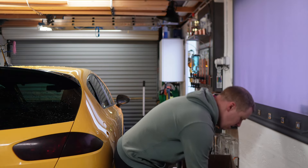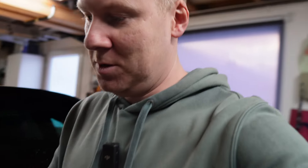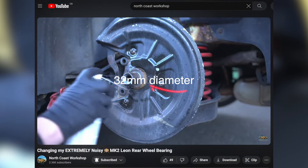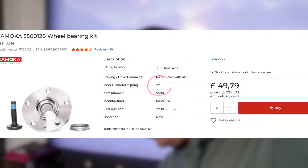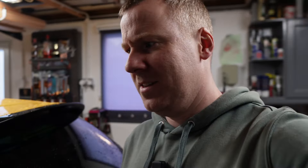Here's me walking through the snow to get to the garage. Here's me putting a box down and raking through it to get the pipes out. Here's me talking to the camera unaware that my microphone isn't working at all - it hasn't recorded any of this next segment. So basically I'm super chuffed because my AutoDoc order has arrived, the brake pipes are among it, and it means the job isn't going to be halted for a few days. Now I'm explaining why I haven't fitted the second wheel bearing to the other side - both my hubs on the back are slightly different. The mounting shafts are 32mm on one side and 30mm on the other, so I'm now short the wheel bearing for the 30mm shaft. Really strange - I wouldn't expect them to be different.